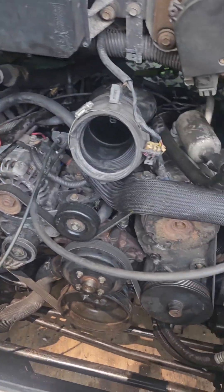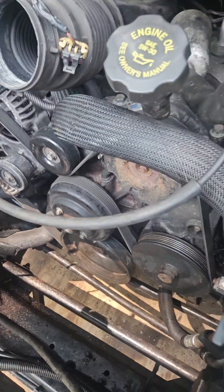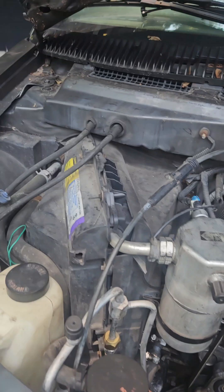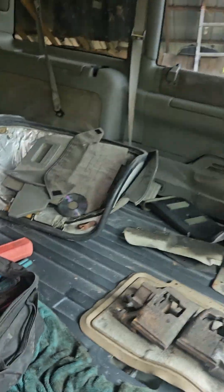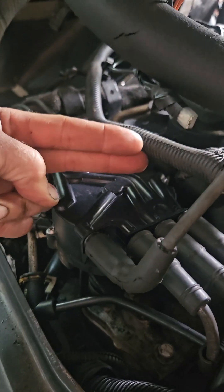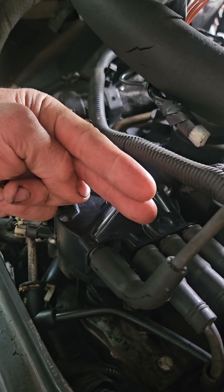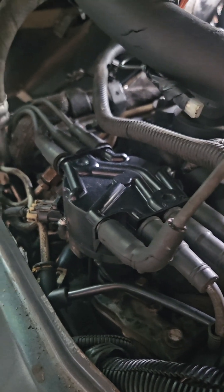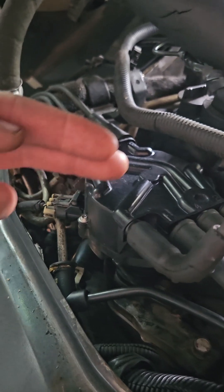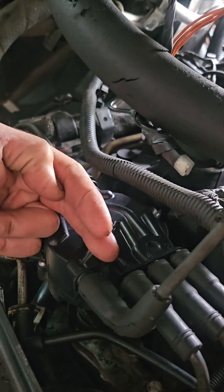Basically got everything lined up as far as on 350s. You got two timing marks down there. You want one timing mark under the vehicle and one up top on the pointer there. Then you drop in your distributor, which is right there. You want the rotor pointing a little bit before the number 6. When it drops in, it'll rotate and it should be right at the 6. Make sure your oil pump — it's like a flathead screwdriver — you can stick it down in there to line that up. You want that lined in front of that 6 position there. That way it'll slide in, rotate, and lock in.